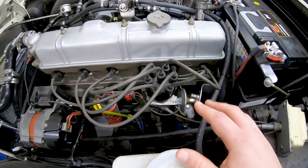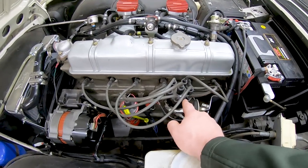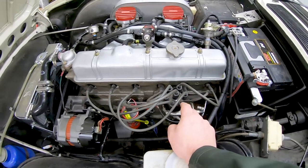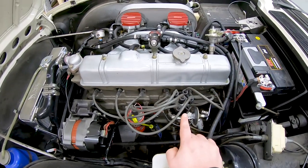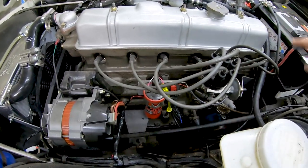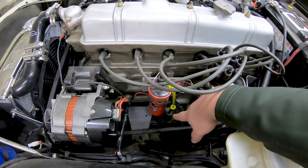On this portion of the engine, I took apart the distributor and replaced the guts with the retrofit kit that came with the system, and that was so easy it really doesn't need much explanation. You basically just take the cap off, pull the rotor off, take the center bolt out, pull the guts out, and put the new guts in and put it back together. On this distributor it was worn enough internally that you could install the new internals backwards 180 degrees — so keep that in mind. If you can't set the timing, that could be backwards; just pull it back up, switch it around, and drop it back in. There's a plug from the ECU wiring harness that feeds up to this igniter chip, which is controlling the distributor and the coil.